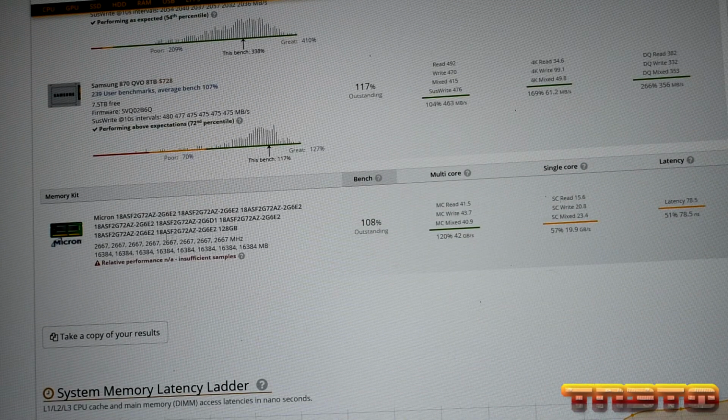Our RAM is going to be a bit of a bottleneck because we have to downclock the frequency because of the memory controller and the CPU. So I had to tweak some of the timings. Our latency is what's killing us the most, but there's not too much I can do on that. With the upgrade Xeon, I might be able to get better timings, and it'll run at 2400 instead of 2133. But when you're using a Xeon and ECC RAM, your latency is not always going to be the absolute best. Day to day, are people going to notice nanoseconds of latency? No, but if you want to be on top of the charts, you've got to have faster timings. But I knew that was going to be a bottleneck. There's not too many benchmarks on this RAM because it's workstation RAM.